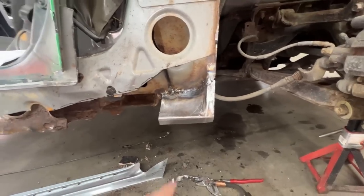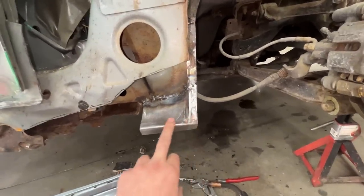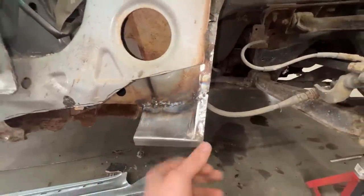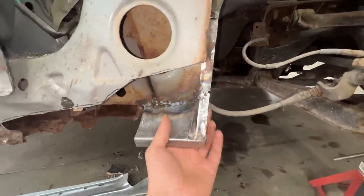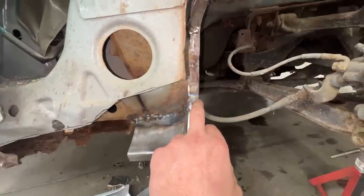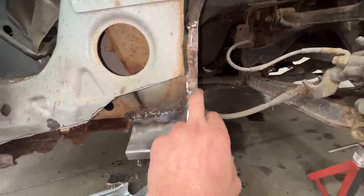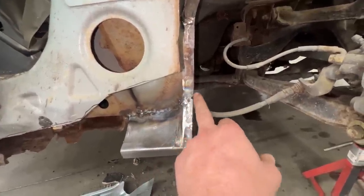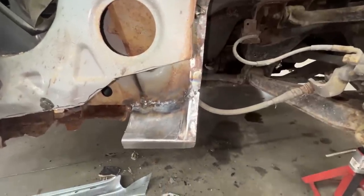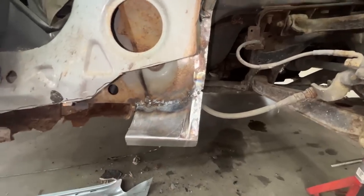All right, so that's what he did. It's not bad at all. It's really good, actually. It's welded properly, it's penetrating everywhere. Here, where he started, the metal is still a little bit thin, so he burnt it. He wanted to fill it up, but I told him to leave it. It's not so important. So this end is done.